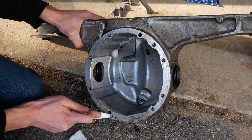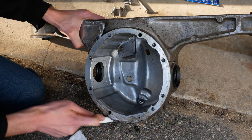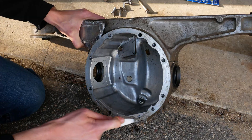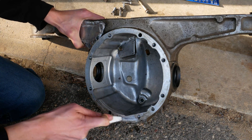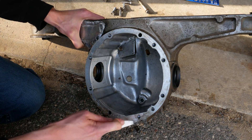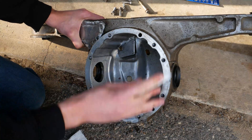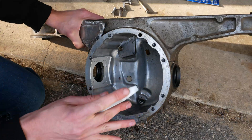There's also leftover silicone sealer from the last time this was sealed, and I'm going to use a nylon knife to get that off. A lot of what we're seeing here is that old sealer, so use a nylon knife to scrape it off and prepare your surface. Once you've scraped off all the sealer, hit it with your degreaser again to make sure it's nice and clean.